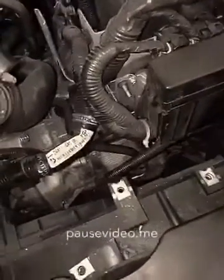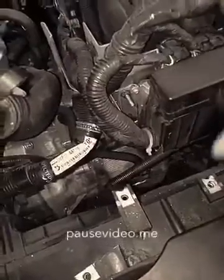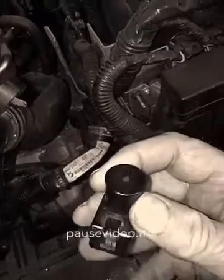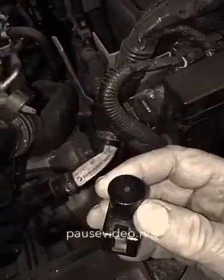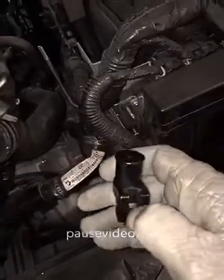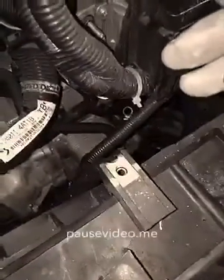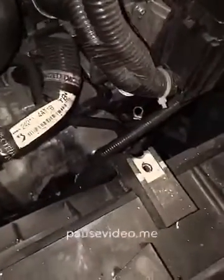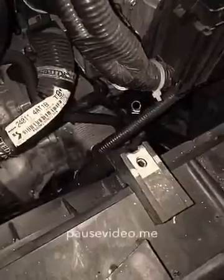Now I have already taken the cap off this thing. The way this cap works, if you notice, there's a little peg right there. My little finger's by it. When it's in the vehicle, you got to push this peg in with a screwdriver, and it's below that metal tab there, and slide the tube back out. And then you can get to your filler neck right down there.